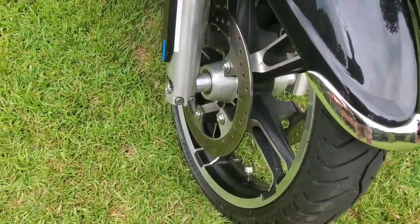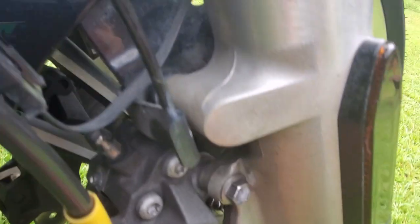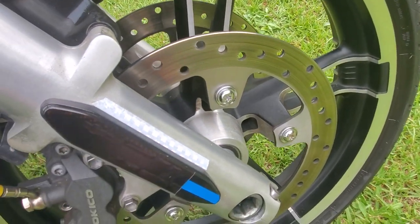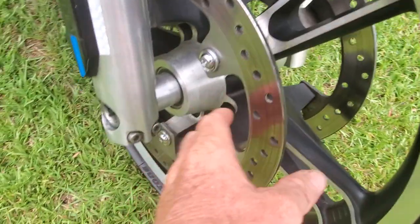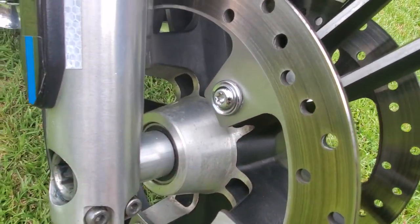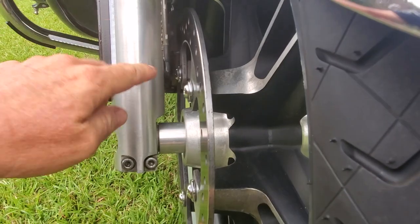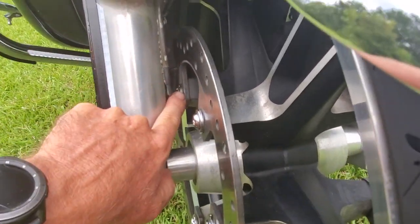There's actually a YouTube video on how to make a Harley Davidson wheel fit. Basically you're going to have to take about an eighth of an inch off your brake mounts — one spot and one spot — or take it off the wheel itself. This particular one had it taken off the wheel. This is actually a floating rotor: it mounts just here, not touching the hub. It floats with five different mounts, and each had an eighth of an inch taken off so the brake caliper can center up with the rotor.